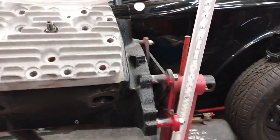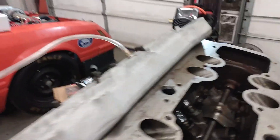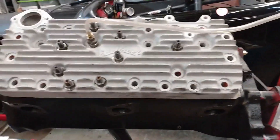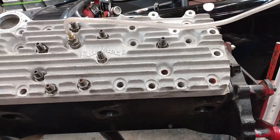When the numbers changed, what I was doing was putting my hand over the intake port — restricting the intake flow — and the numbers look much more like the Navarro head with its very large chambers. That is very interesting. I'm going to continue to play with this and hopefully keep you abreast.